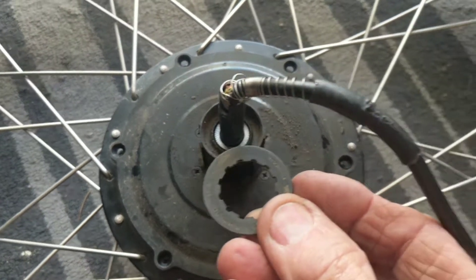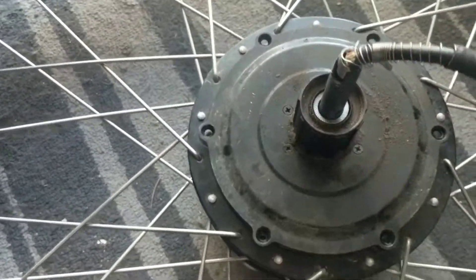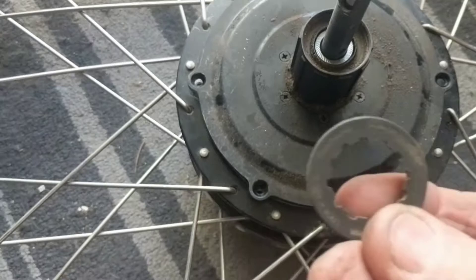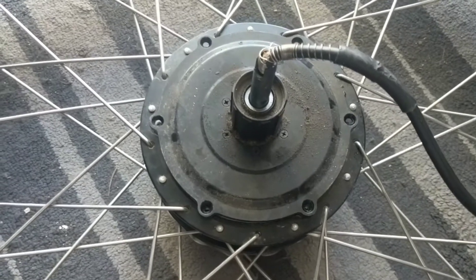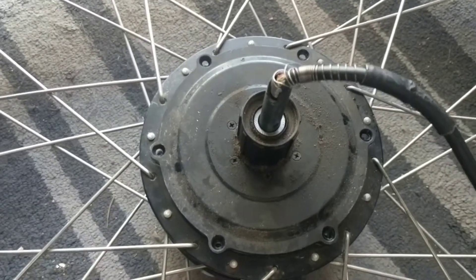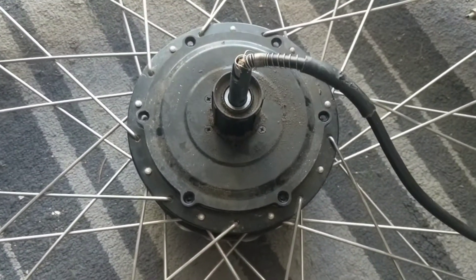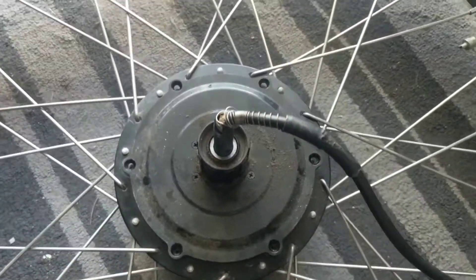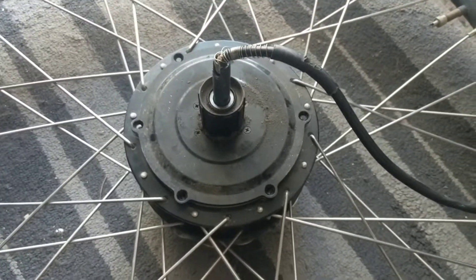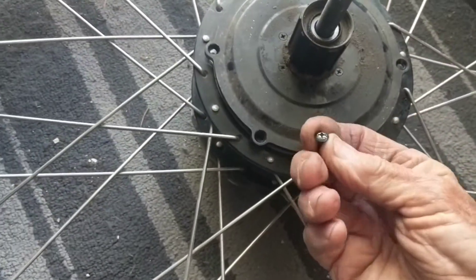You can do it other ways, but I bought the special holding tool that wraps around the sprockets to hold them while you loosen that retaining nut ring. In this case I wouldn't have had to do that because I could get to those screws through the various openings in the big sprocket, but I decided to get that out of the way. Once you pull that nut ring to get the sprockets off, I would advise just getting them out of your way — it's easy enough.